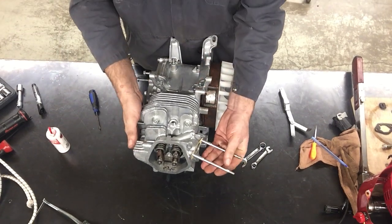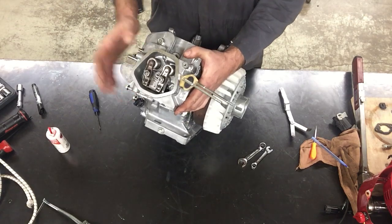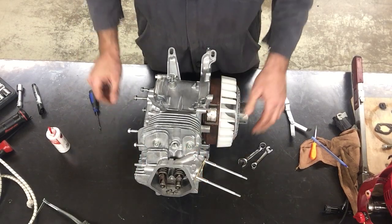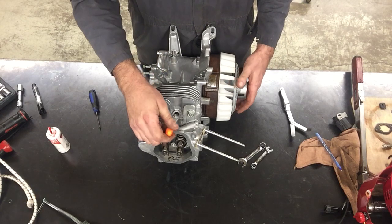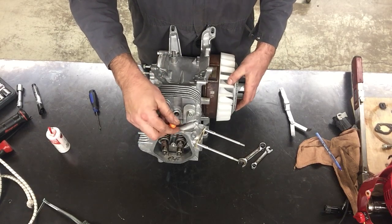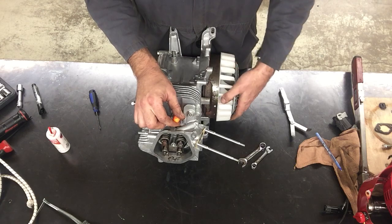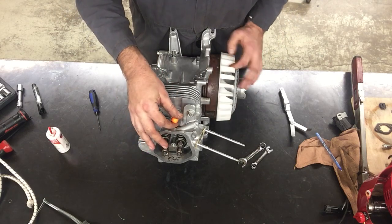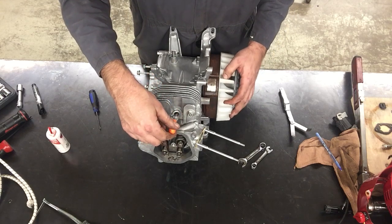The next part of our engine — we've done some off-camera work and put our rocker arms in with our push rods. I want to do a quick demonstration of our four-stroke cycle. The piston is moving down right now and I'm turning the engine the right way. The exhaust valve is opening as the piston comes up, so that would be our exhaust stroke.